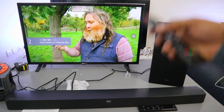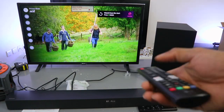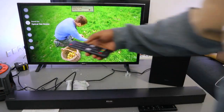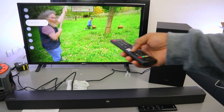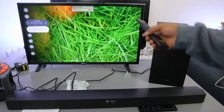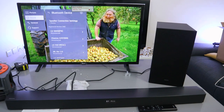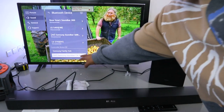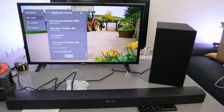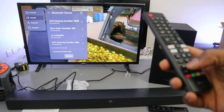The TV is currently in optical mode. Go to your TV settings, scroll down to sound, and you'll see optical out. Go to sound settings, then scroll to Bluetooth device. Scroll down to device list and select enter — it will start searching for available Bluetooth devices. The soundbar shows as Samsung Soundbar C400 series. It picked it up — select it and it will start connecting. It's now connected.